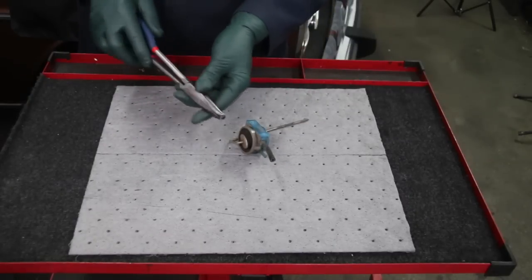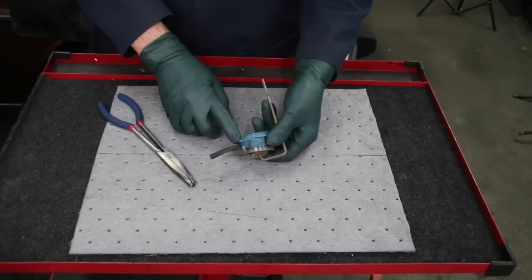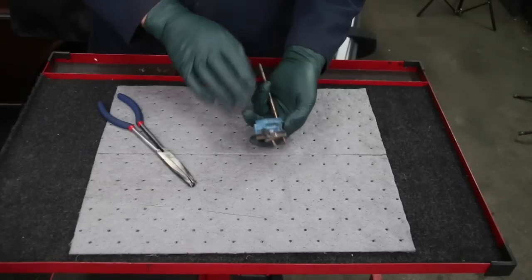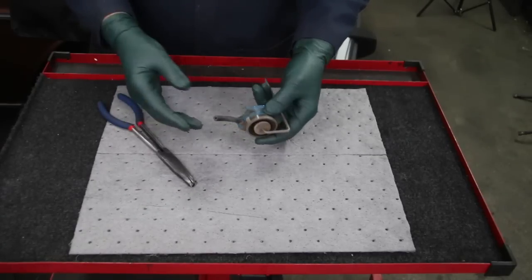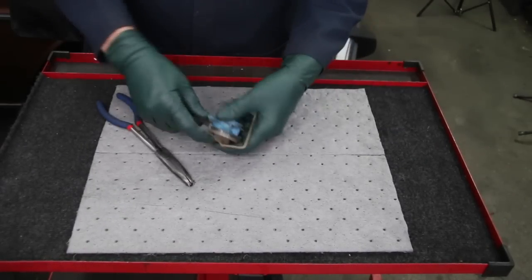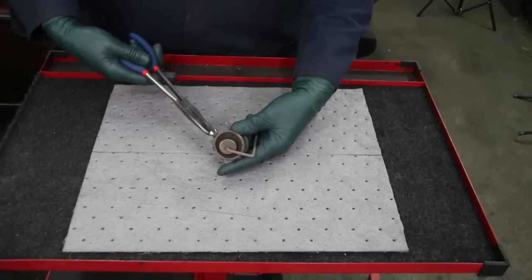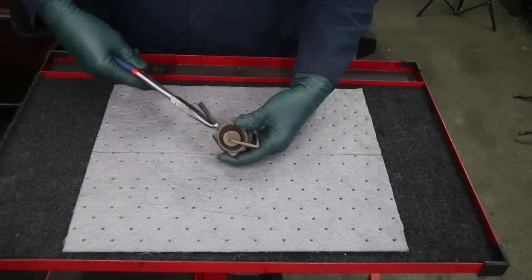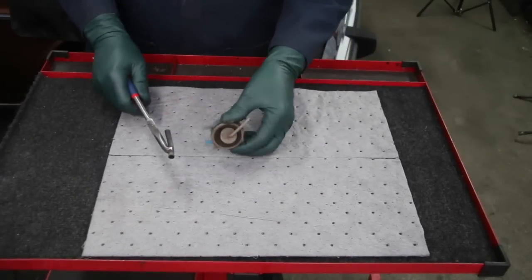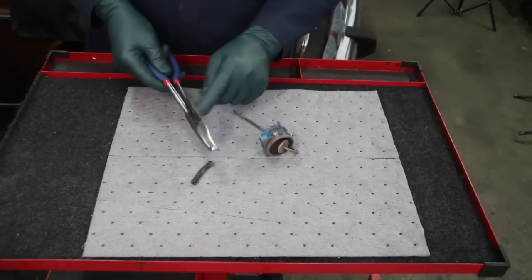As well as the fuel injector return hose that you just saw, this tool also works extremely well on vacuum hoses, particularly those vacuum hoses that have been stuck to a nipple or fitting for a very long time. It's so typical on these actuators — rear trunk actuators, gas door actuators, door lock actuators. Any of you ever tried to pull off this rubber hose and the more you pull on it, it's just like one of those Chinese fingers — it gets harder and harder. Watch what happens when I take this tool, come in here, lightly grab right around the hose where it goes over the nipple, twist until it breaks free, loosen up my grab a little, and it just comes right off. You can use this for vacuum hoses in and around the engine and your vacuum door lock system.